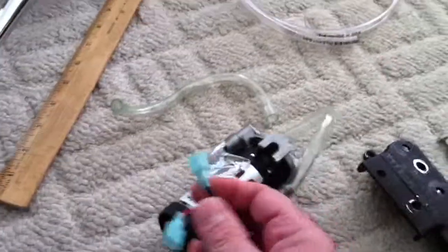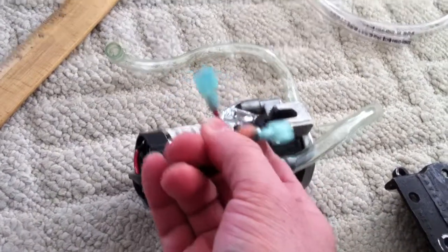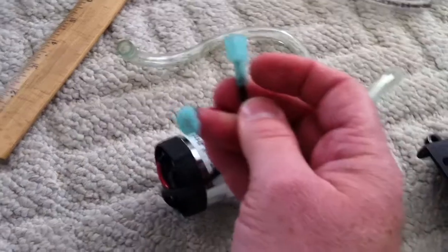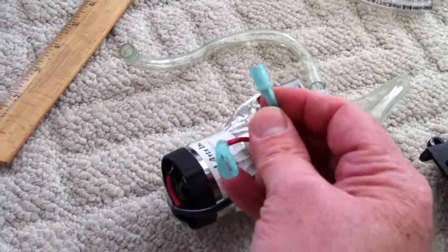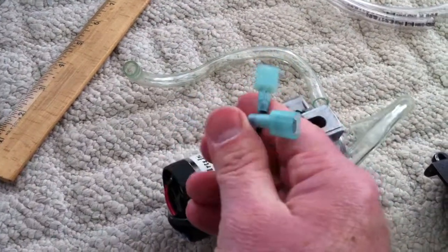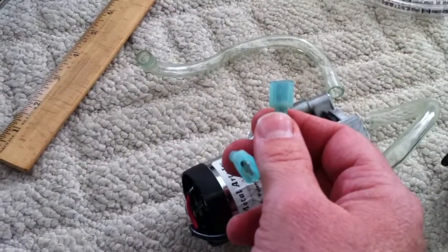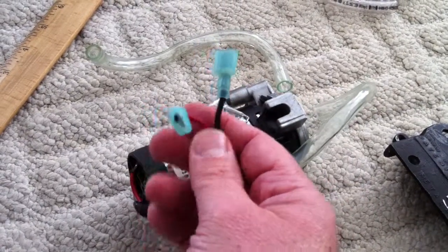One thing I also wanted to mention: when you wire these up, black goes to black, and red goes to — I think it's white or yellow on my Harley. The Metal Arts kit said you may need to trim the connectors to get it to fit, as there are some black clips on the Harley horn mount. Metal Arts is right, it does not fit exactly. So all I did was take a carpet knife or box knife and cut a split on each side of the clips, and that enables them to work together very well. I've had this on my bike and it does work. The shorter horn wasn't sounding, so I've taken it apart to fix that and to switch the order of the horns. I used some electrical tape on the wiring to weatherproof it once it was together.